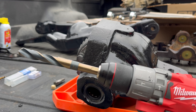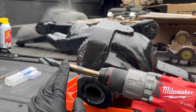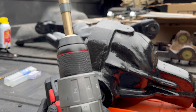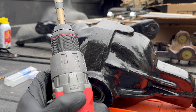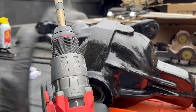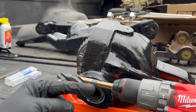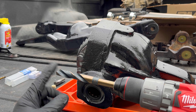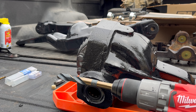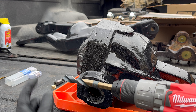This is a really big drill bit, and I've been consulting with my brother who's a machinist. He says you want to run these slow — for this size, about 500 RPM, which is pretty slow. On my Milwaukee drill I've set it to number one and dialed it all the way back to three. He says it's safer to start slower and work your way up visually. At slower speeds, if you're doing it properly, you should see nice long continuous strings of steel coming out rather than little fragments. Dip your drill bit in oil and keep it lubricated during the entire drilling process.